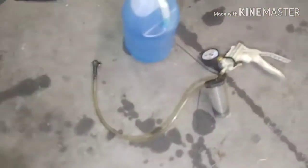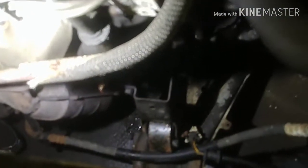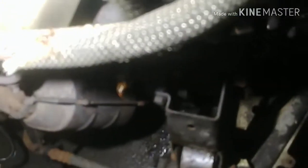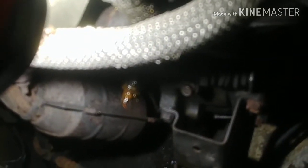And whenever I place my Mighty Vac brake bleeder on something, I always use grease to seal the tip and its connection, because normally you get a little stream of bubbles in the line, and that reduces any kind of a vacuum leak on the vacuum system itself. So it's a top tip, so you're not chasing leaks when there aren't any.